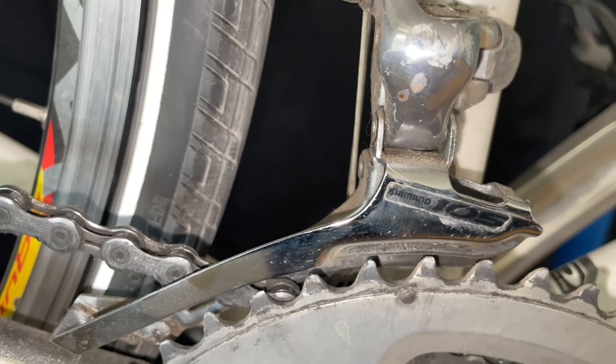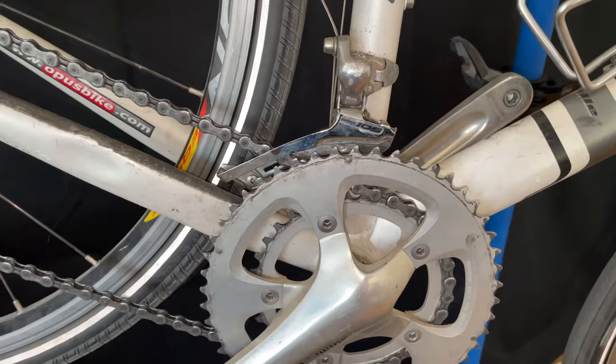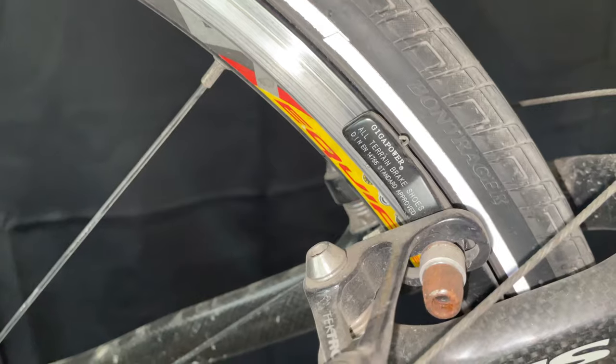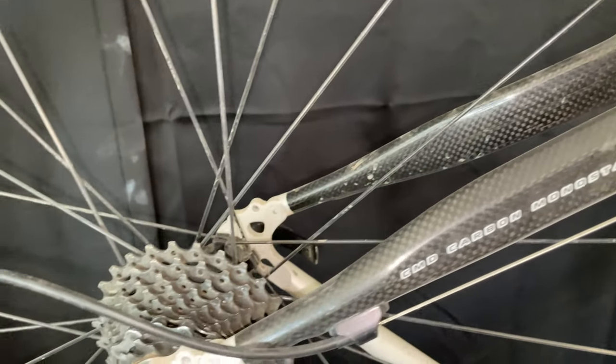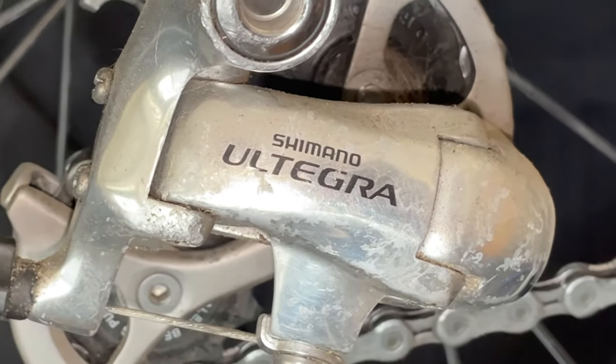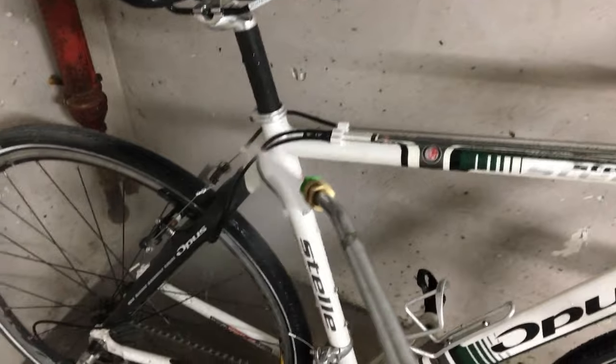Apparently the shifting is a little jangly, so take a peek at the brakes here. I've already done these, so it's just checking out the rest of it. Got an Ultegra rear derailleur. I noticed that the rear brake track is getting a little concave, and that means that it's just getting worn down. It's something to think about for later. And then I'll just move over into the washing phase, because this bike is pretty dirty — maybe used after the rain or on the gravel trails.